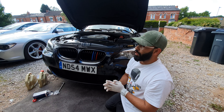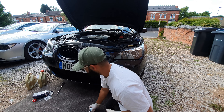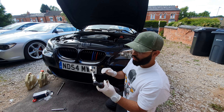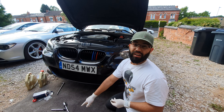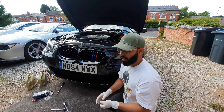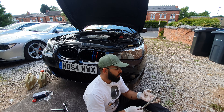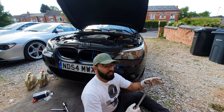Once you've got all of that done, now is a perfect time to look at putting on the drain plug. I've got this here and I'm just going to go underneath — 17-millimeter. Start tightening it up with your hand first, purely because you don't want to cross-thread anything underneath there. Once you've done that you can use an electrical ratchet if you like, but I'm happy to use a breaker bar. Just jump underneath and get the sump plug back on. Tighten that up — I believe it's 25 Newton meters, or as most mechanics will say, tight but not too tight.